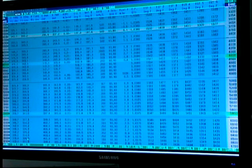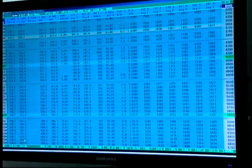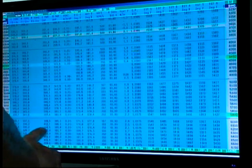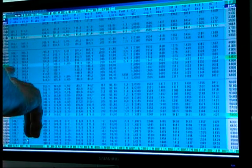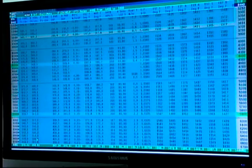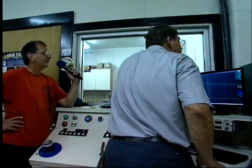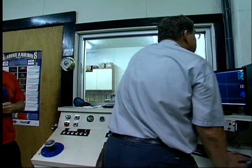405 horsepower — that's up from 385, so that's like 20 to 25 horsepower. And the torque? The torque didn't change much — almost 377, so the torque didn't go up as much as the horsepower. The torque is just what it sounds like — the low-end grunt that makes the motor go. Horsepower is more of a high-end thing. A big-block Chevy is born with torque, where the small-block Chevy is more about horsepower. So the trick is to try to get both the torque and the horsepower up.